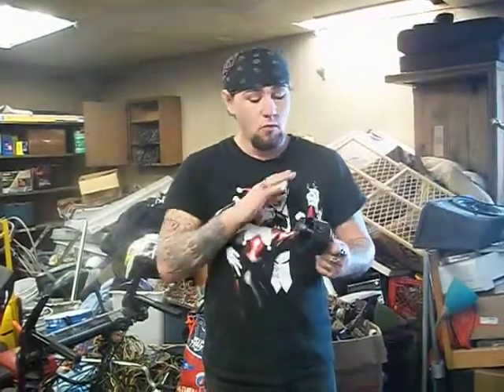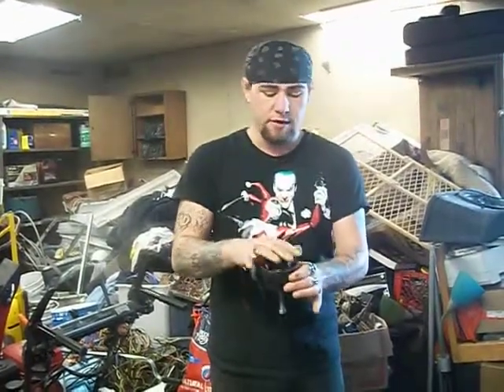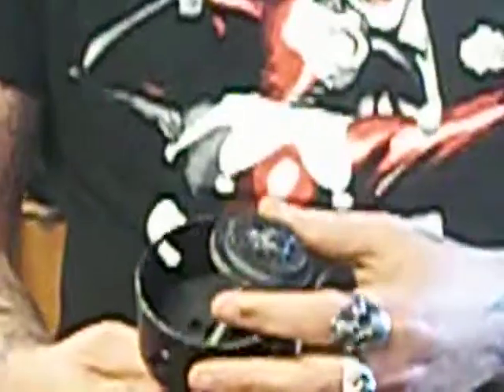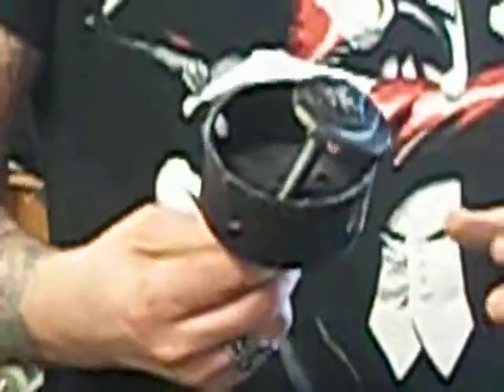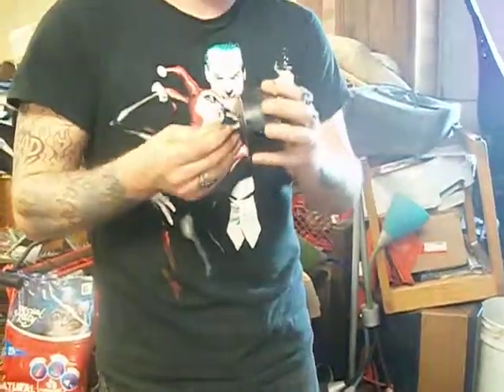The homemade diaphragm spring collapsing tool that I made worked wonderful. I was able to collapse the spring down a lot further than I was before without snapping it. Everything went together real well. All it is is a proper sized hole saw — I ground the teeth off, welded a washer to the top as centered as possible. That's a threaded rod, some washers. You've got to grind down one washer so it fits tightly in where the throwout bearing goes. When you do that, you can put a lot more pressure on it than if you had a loose fitting washer in there.